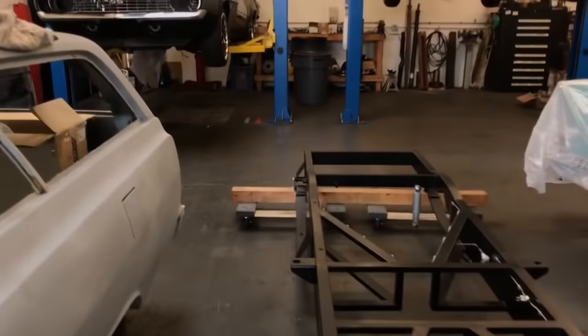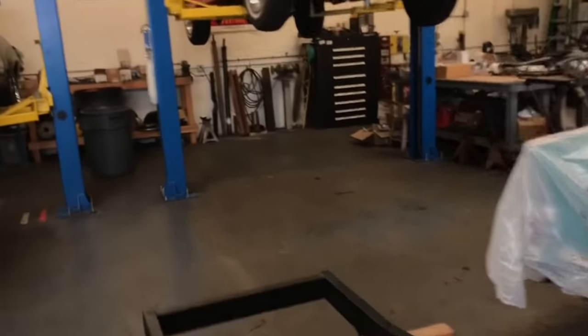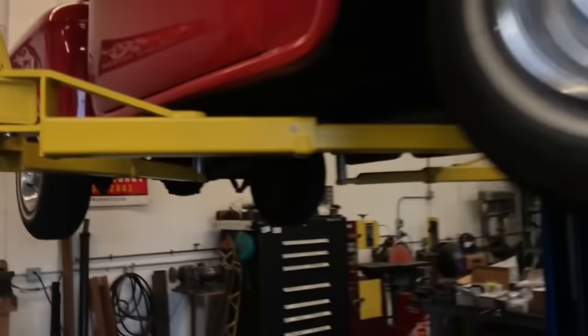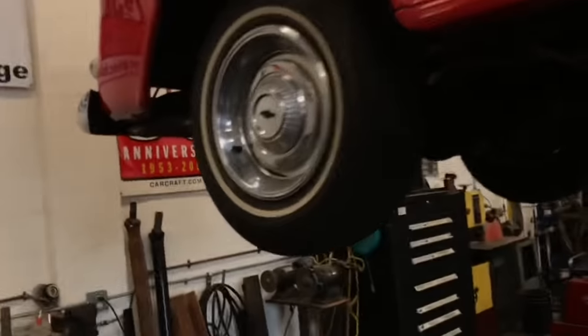There were some things I already found on this truck that would make it kind of creaky and sketchy to drive. The bolts that hold the bed on, and the bed is actually the structure of the rear frame, stopping it from twisting. You can look in here and see that there is a plate right here. It focuses. And then the nut plate goes on the top, and the bolt goes through, and that ties that side to this side. Well, three of them on this side don't have a plate in them. They were just nuts on top of the frame rail. So, not too cool.